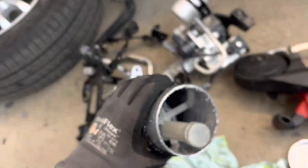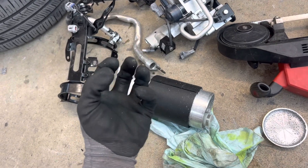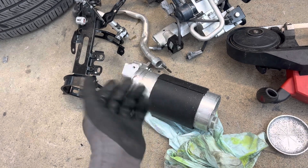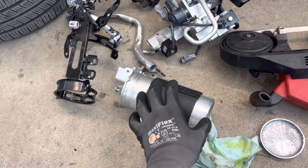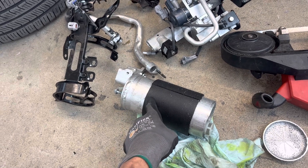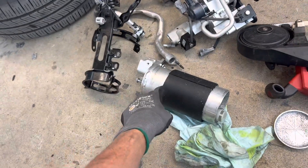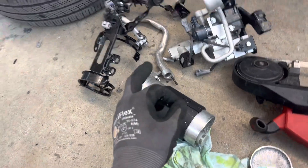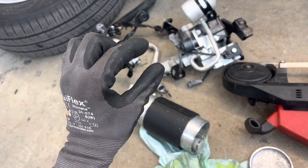Just that desiccant material alone can soak up two or three ounces of oil — it stays in there like a sponge. If you took that desiccant material out, you can't squeeze it because it's all BBs inside, but if you were to soak it in 99.9% pure alcohol, the solvent from the alcohol would mix with the oil in the desiccant material. Say you had it in a 1000 mL beaker, you wring out the desiccant material and evaporate off the alcohol — you'd be left with pure oil that you can measure.